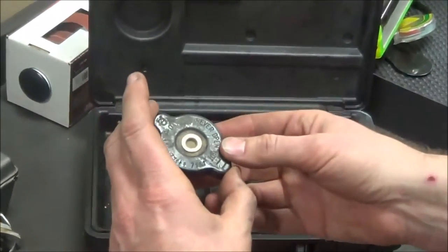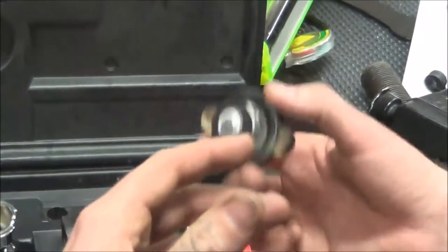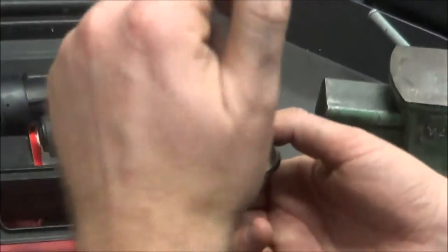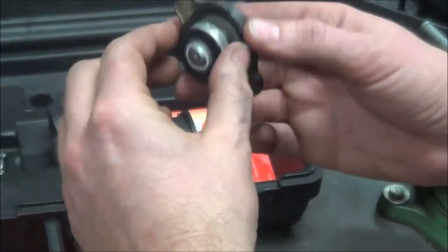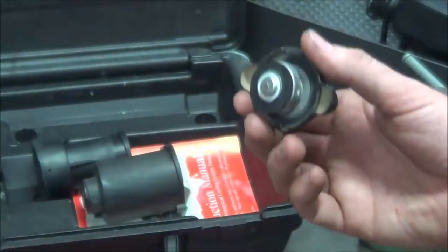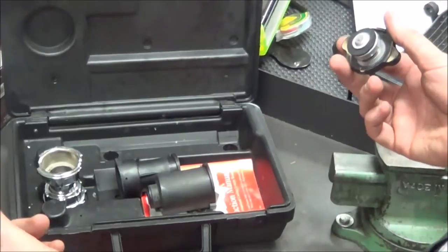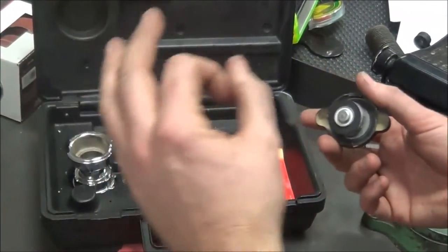Here's another problem: if I have a customer with a bike that won't heat up or is overheating, I can't just say 'it must be the cap' or 'it must be the thermostat' — we really need to find out what's actually wrong. When people test these caps they fail them a lot, but often they're just plain dirty. Have you ever pulled radiator hoses with a bunch of corrosion? That goes throughout the whole system. We're supposed to use distilled water.